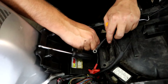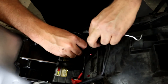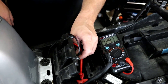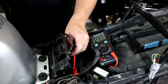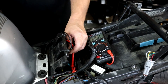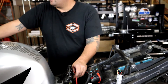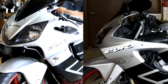We went ahead and connected the regulator ring terminals directly to the battery. There's not enough room to show it well on camera, but now we have a direct connection to the battery. We put the voltmeter on it, fired it up, and it looks like we hit 14.9 volts at idle — or maybe 14.6. Either way, we're getting good charging right away, so the charging system is working well. That's a successful stator and regulator replacement on a CBR 600 F4i.